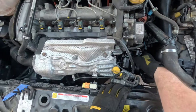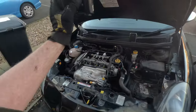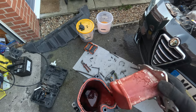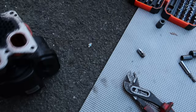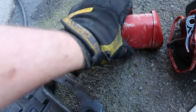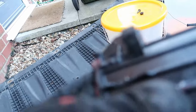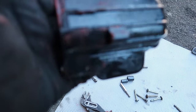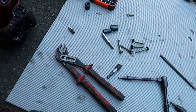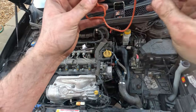All the bolts are out — oh yes, there she is! The EGR cooler is out. Here it is — the cooler is this bit here. You can see all this red gunk; that's the rad sealer the previous owner put in, so I'm going to clean all that off. I've had a look and honestly I'm not sure where it was leaking from — the seal might have gone. But we've got two brand new seals in our kit, so I'm going to clean this up and go from there. I'm going to clean this in the kitchen sink.